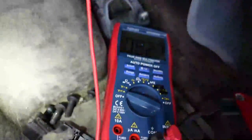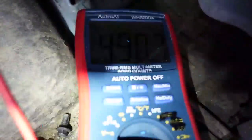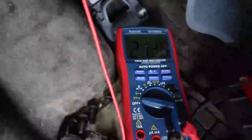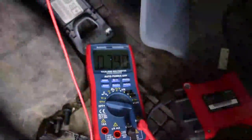So, all right. Right now, I have like a trace voltage. It was kind of interesting. It kind of went down. It's slowly going down. This is with the key off, key out. Here, actually, I'll show you guys. Maybe you can see or not. I'm back probed, my little wire is going right down there to my meter. So we got the key out.